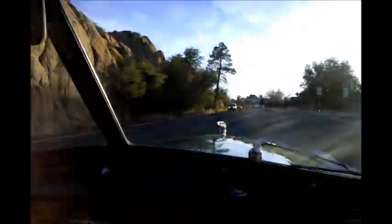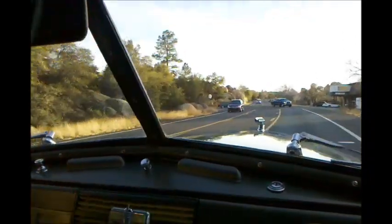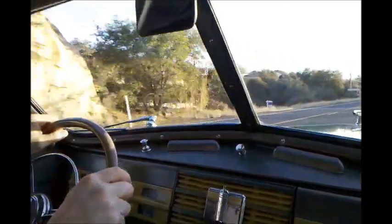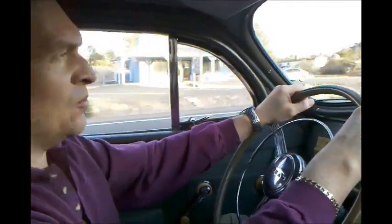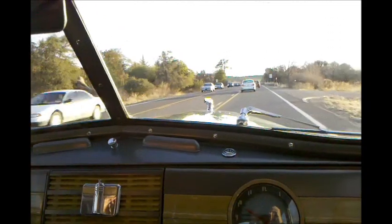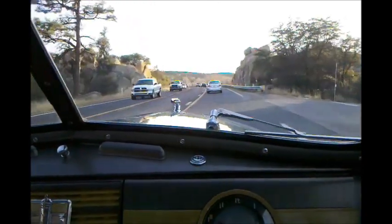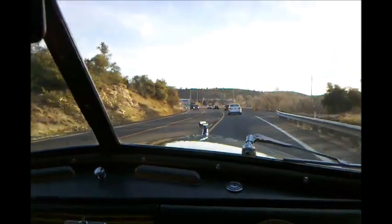A little press and shift — she's now running in third over. You can hear the RPM on the engine drop way down, so she's getting very good gas mileage in third over. You can run her all the way up to over 100 miles an hour, although that won't quite show on the instrumentation because Graham had a built-in lower rate on the speedometer — it reads about 17% low. Plus there's an overdrive scale to read, so you have to know what you're looking at to understand your speed, but you can always time it, which we've actually done, and this car will go as fast as I've told you.